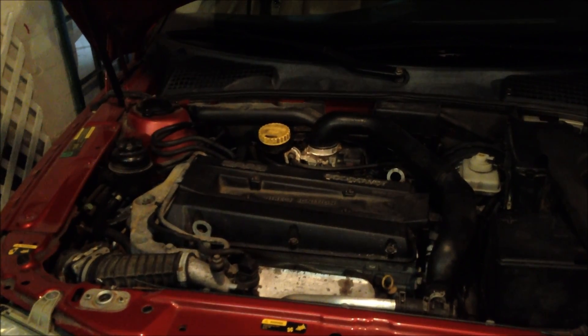Just as suspected, the car went into limp home mode, so I had to fix it. You have to remove this cover up here that I'm illuminating, and underneath is the wheel. There's a very small piece of wire down there that I'm illuminating, and you have to pull that excess wire out toward you so that you can recoil the spring. If you pull on this spring on top and the coil moves with it, then you know you've gone into limp home mode. When you pull on that smaller wire at the bottom, pull it toward you at the front of the car. Then take that black wheel on the right and push it away toward the interior of the car. You'll hear it snap and you'll know that you've recoiled it.